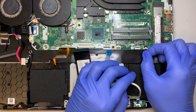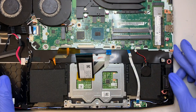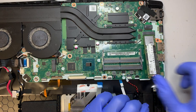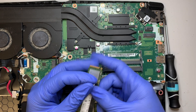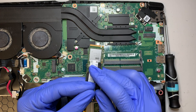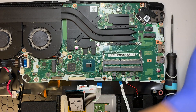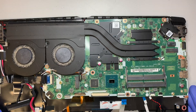This is your CMOS battery — go ahead and disconnect it. If you want to upgrade your M.2 solid state drive to a larger OS capacity, you can replace this. This one is 256GB — if you want to go higher, just replace the M.2 NVMe drive, get a USB Windows 10 installer, reinstall Windows, and you should be good to go.